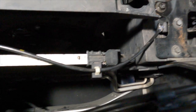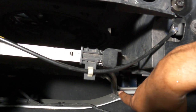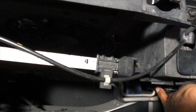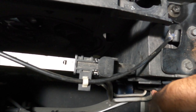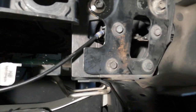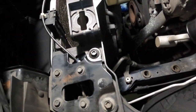Looking down, you'll see the lines running from the AC condenser — these are hard lines. There's a plastic bracket here that holds those lines in place, with one 10-millimeter bolt on the top. Once you remove that bolt, go to the rear and push that bracket out from this side. You may need to use a tool; I used a flathead screwdriver and gave it a push and it was able to be removed.